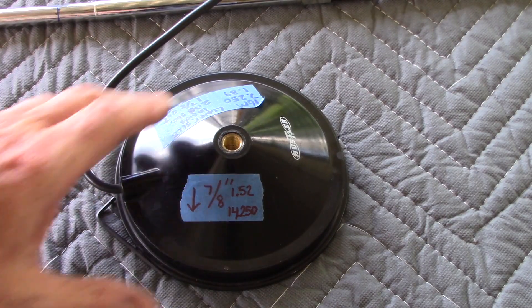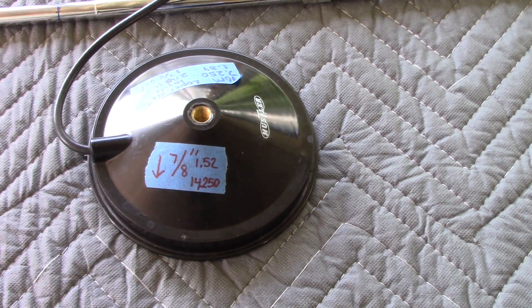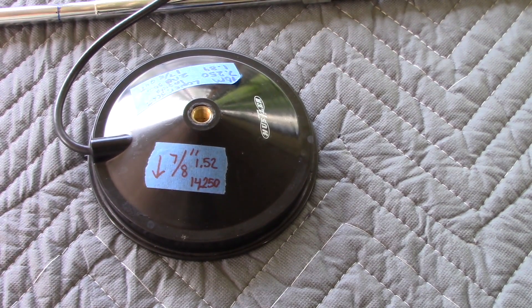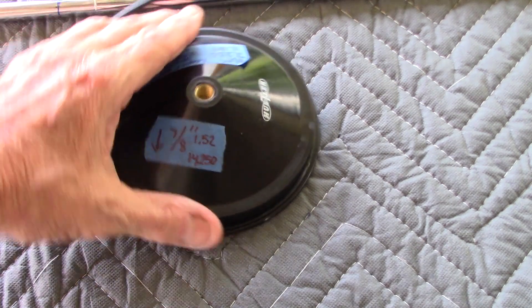What I use is a single magnet mount for these ham sticks, because I don't drive with them. If you're going to drive with a ham stick on your vehicle, I recommend the three-magnet type mounting. It uses three of these, and it probably gives you a little bit better coupling to the surface of your roof. But I don't drive, so I'm not worried too much about that.